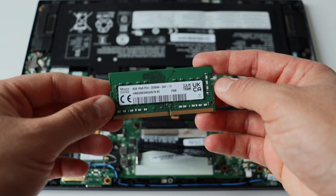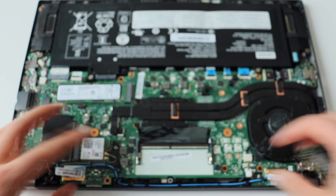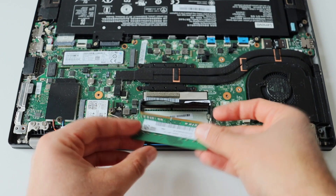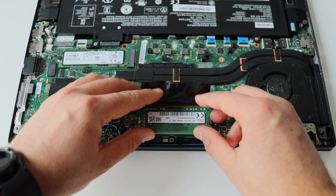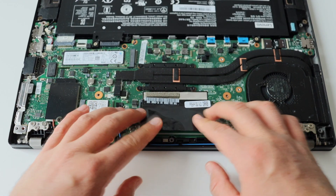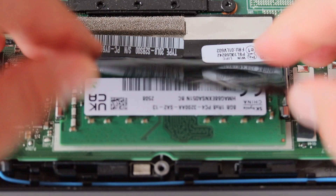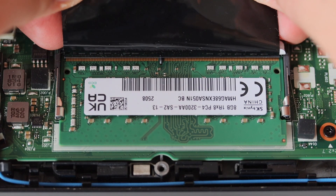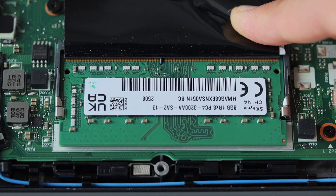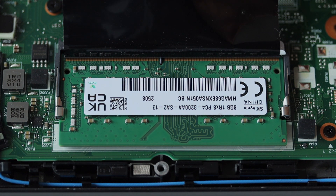Here is another quick look at the new memory module, and now let's proceed with the most important step and plug it into the SODIMM slot on the motherboard. Carefully make sure that it is properly aligned. With both hands, hold it at a 30-degree angle and plug it into the SODIMM slot until it clicks. You have to slightly and carefully push down the memory module to click. Let me zoom in and show you the details about the installed extra memory module, and I'll also lift up the protective cover so you can have a better look.